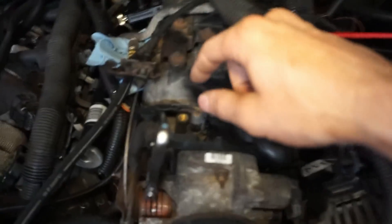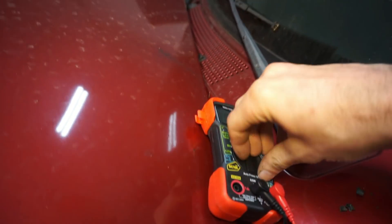It's a normally open switch instead of a normally closed like this one, and I kind of have a different idea for it — just to pull timing instead of actually killing the ECU or killing injectors. Similar to the other idea I had with the intake air temp sensor. I did test that at the track where I would push the button, it closes the circuit and pulls timing — that does work, it works pretty good.